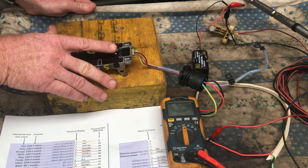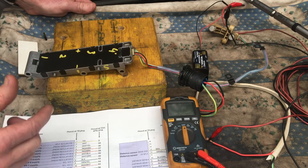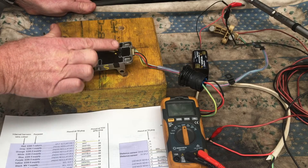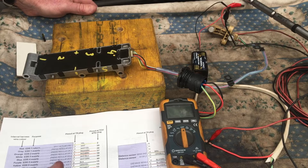When you look at PWIS, they detect where a magnet is relative to the sensor. PWIS gives a central position of zero and either a plus or minus, which is what that plus or minus is — when you move it, it's in millimeters, up to about 12.7 millimeters. Anything beyond that it says is out of limits.